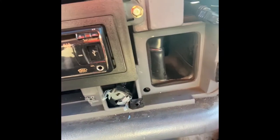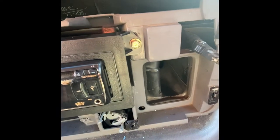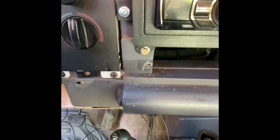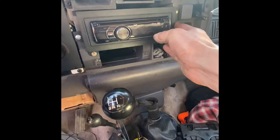Okay, I got the stereo in. The screws that were already in there — the holes were huge — so I put some big old screws in there. I had a big gap behind it, so I drilled a hole and put a little nut behind it as a washer. That thing's nice and tight in there.